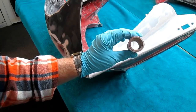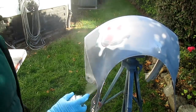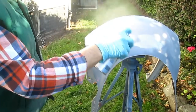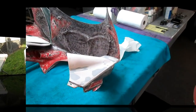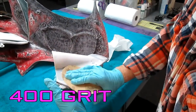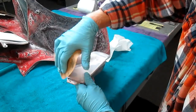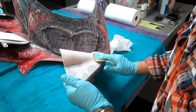And that's where having a sanding block comes in really handy. This is just ordinary sticky back 400 sandpaper. And it'll take about an hour, roughly an hour, 45 minutes. Just get this nice and get all the edges radius, most important thing. And all the surfaces that are flat, done with a block, all the radiuses done with that little tool I just showed.